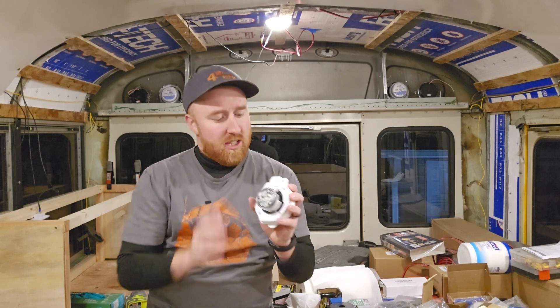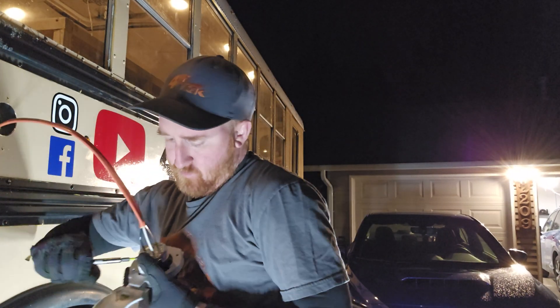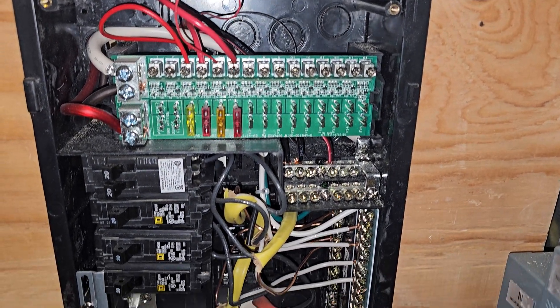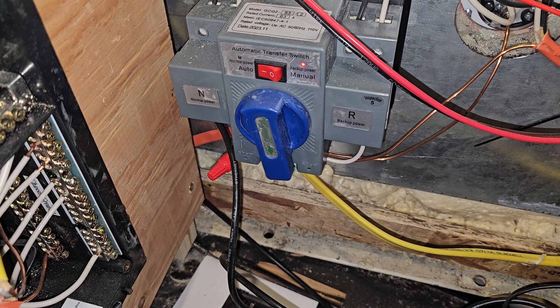The physical wiring of the shore power inlet is pretty simple — three wires stripped back: the ground, the white neutral, and the black hot. Then bolt it right up to the outside of the bus. With everything now wired into the breaker box — breakers installed, fuses installed, hot to hot, ground to ground, and neutral to neutral. I also installed an automatic transfer switch, which sets shore power as the primary, but if shore power is not plugged in and the inverter turns on, it'll automatically disconnect shore power and connect to the inverter. That way I'll never overcharge, it'll stay at 30 amps, and always prioritize outside power before hitting the inside power.